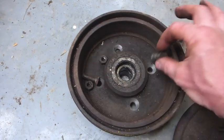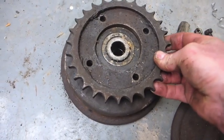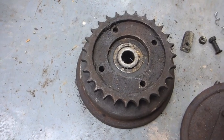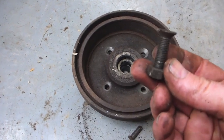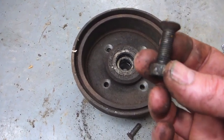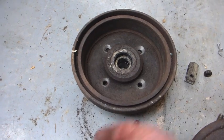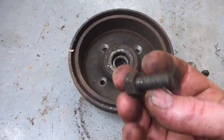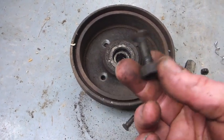Here's the clutch drum. These are the countersink bolts that hold the drum to the drive sprocket. The chain drive is permanently driving the drum, which is free to freewheel should you release the clutch. When I took my clutch apart these little countersink screws were all loose and the heads were deformed. If ever you get this far and you replace these screws — which you'd only do if you're replacing the sprocket or if they've come loose — you need a fine threaded screw that fits nicely. You can't stick an M10 coarse in there; the coarse thread won't do up tight enough and it'll all come loose. You need something fine thread.